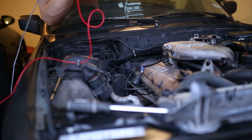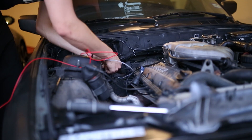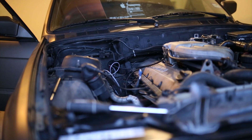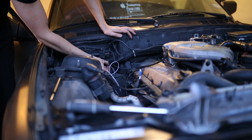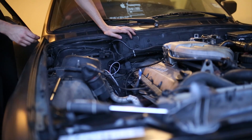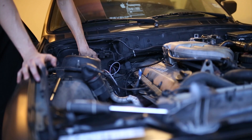All I'm going to do now is take this wrapped up Phillips head screwdriver with the wiring attached and simply push it through the hole I made in the firewall boot. I pulled the wideband wires through. Now I want to reiterate: you need to be extremely careful when drilling next to this wiring harness. I actually nicked the shielding on it, so I'm going to tape that all up. If I did this again, I'd suggest drilling a new hole through the firewall and wiring it through that way.